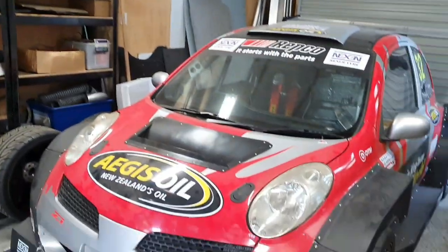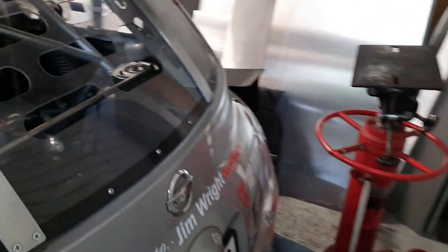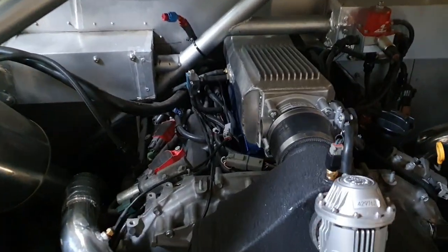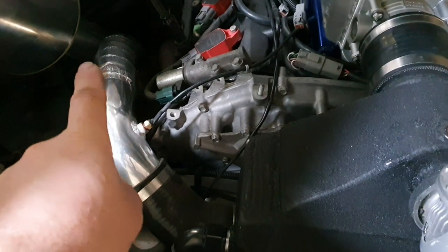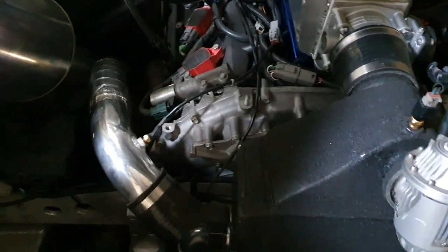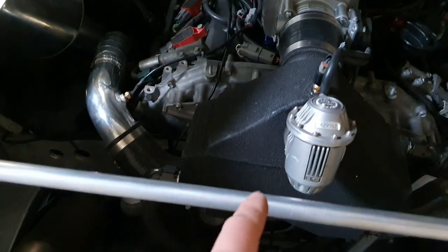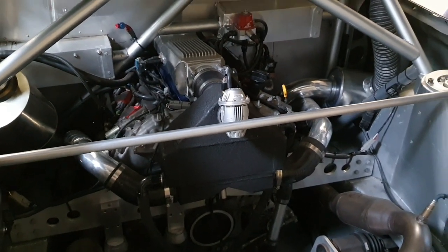I tinkered some more yesterday on my day off from the Gloria. I put a new sensor in the back of the engine bay. With our Link 350Z G4 Plus plug-in ECU, we've now got an air temp sensor post-turbo pre-intercooler, so we'll know how hot the air is. I've run out of temp sensor channels because we've got so many going on, so we know how hot the air is coming out of the turbo and how hot it is coming out of the intercooler — so we can see how rubbish my Chinese intercooler is.